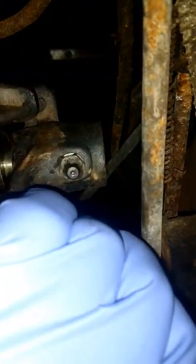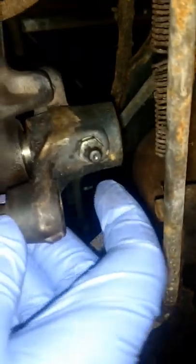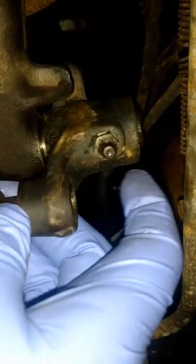Over here this is all hooked up already, I just need to put the clips in. This is a little tricky getting in, but my pedal is loose now so it's actually easier than it would normally be. I had a new bolt and a new eyelet piece here — I had it sandblasted, pretty clean. The magic number here: this bracket is measured to be two inches from the center of this bolt to the bracket.